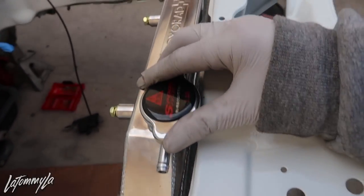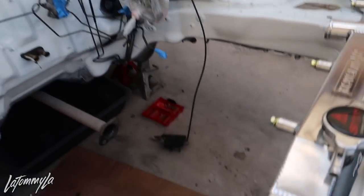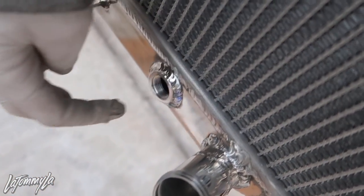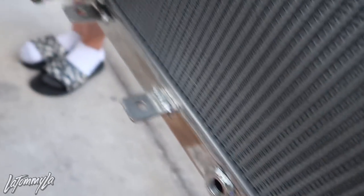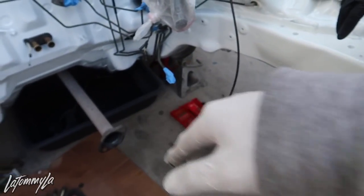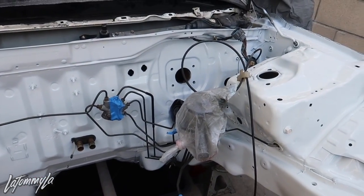Now I'm going to put the brake booster back in. I noticed there's a drain that was missing a plug right here, so I need to find a plug and plug this up because we don't want coolant spilling out. We do have the K-Tune hoses for the RSX — this one will go up to the thermostat and this one here will go to the upper fill neck on the K20.